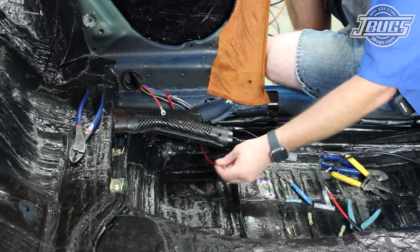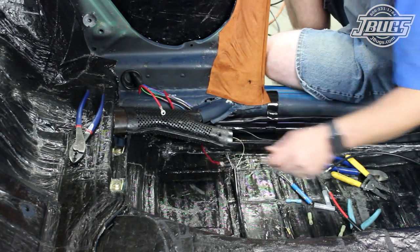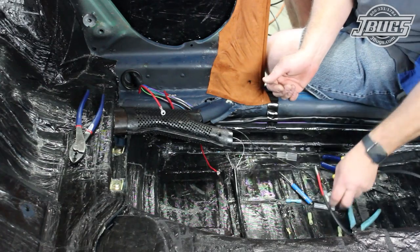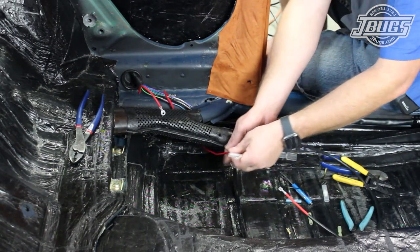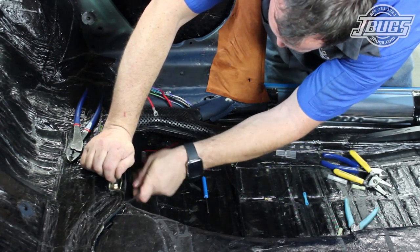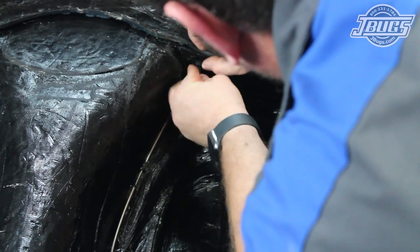So we don't confuse our various thick red wires, we pull the one red wire coming from the harness that has a quarter inch female spade terminal. It will plug into the starter wire with the shrouded connector. Rerun it through the floor pan and install a brake line grommet around it.